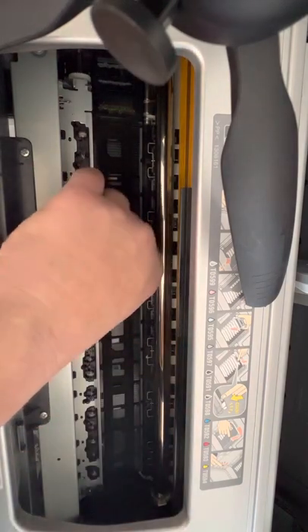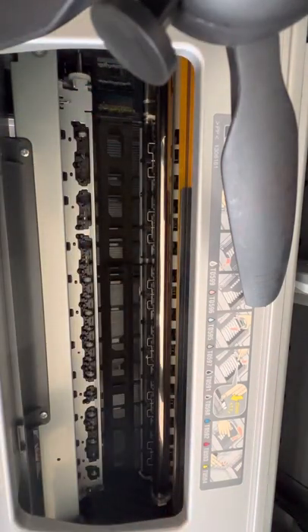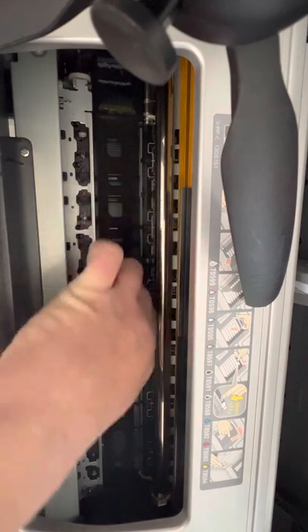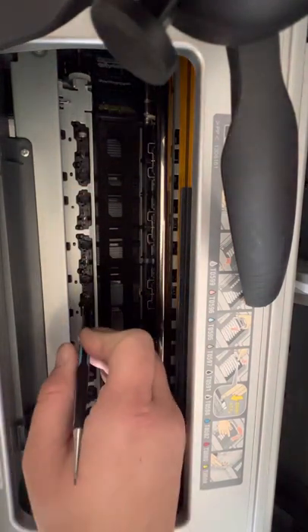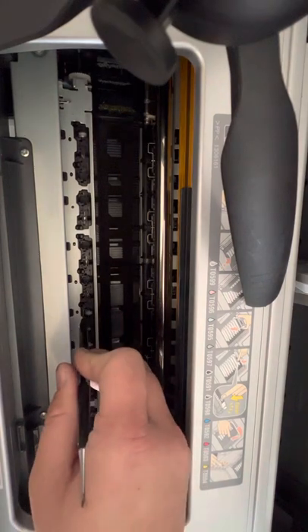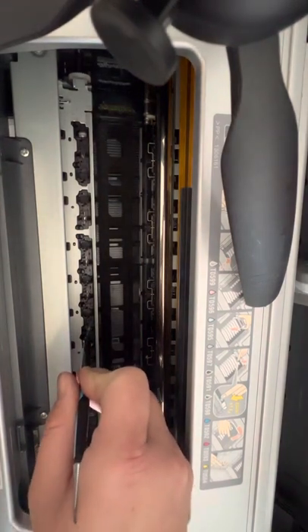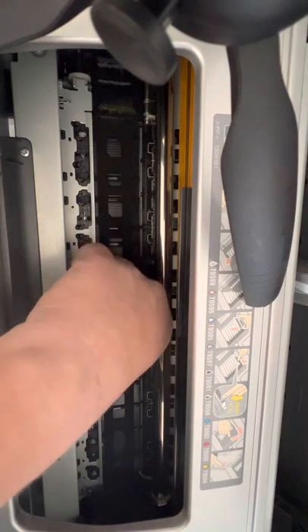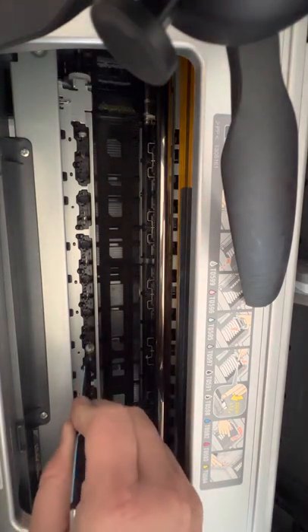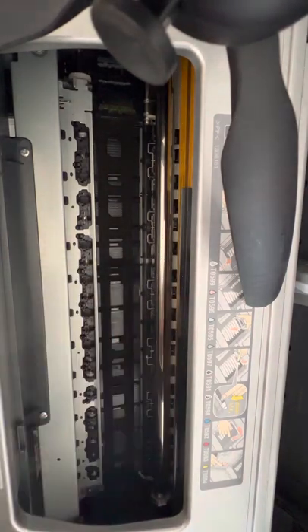Sometimes you've got to get in there a little bit once it's up, because you grab with your fingers, pull it out and pull the spring. You need to remove these rollers so they don't put tracks on your printouts. I like to leave the outside rollers.